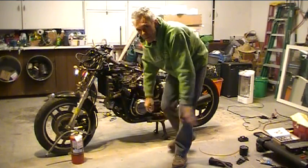Okay, I think what probably happened there is I ran off from the fuel that I squirted into the intake, so probably the needle and seat valves are a little flaky. Not sure, as I got a lot of fuel into the float bowls, but I think I'll try squirting a little fuel down in there one more time and give it one more shot.